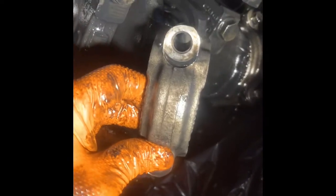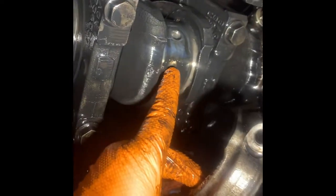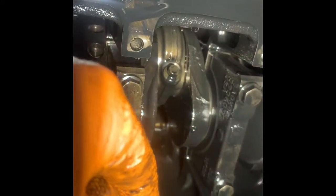We're getting our rod bolts removed - those are 12-millimeter and on fairly tight, so you're going to need a breaker bar or a bigger wrench or a stout torque wrench to remove them. We're taking out number three here. We're going to push the piston up through the cylinder bore. Make note of which direction your caps are facing - there are numbers on the inside of the rod and the end cap. Those face the driver's side on my truck.